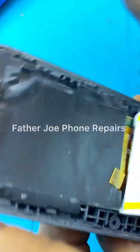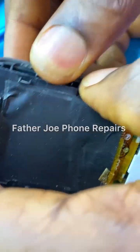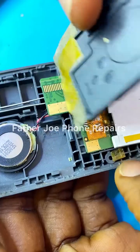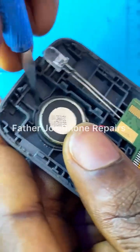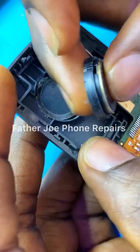There is no way you can bypass this and have the customer enjoy the phone. I have seen some technicians bypassing with a diode — in that case it will add percentage, but I will not recommend it, since the phone will show over battery temperature. I recommend just changing the IC at once to fix the issue.